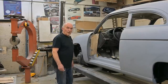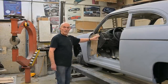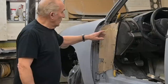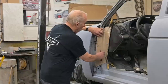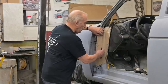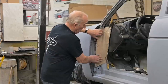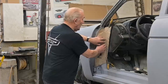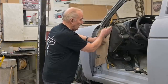Hi guys, today we're going from a 50s car to a modern car. This template is in effect like a time travel machine. In four inches we've traveled over 60 years. By forming this up and creating the bands to accommodate the structure underneath, we're covering up the hinges, making it look neat, and transitioning to the curvature of the present-day car.